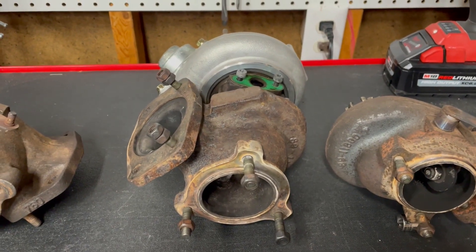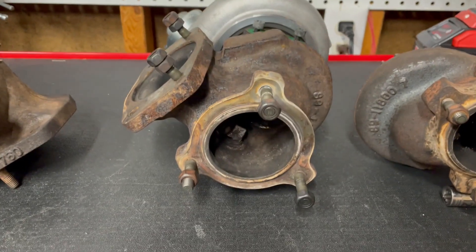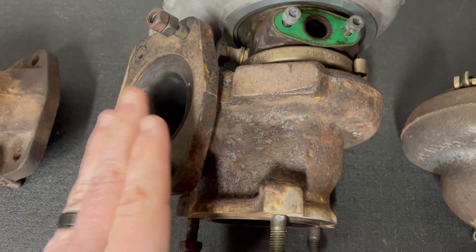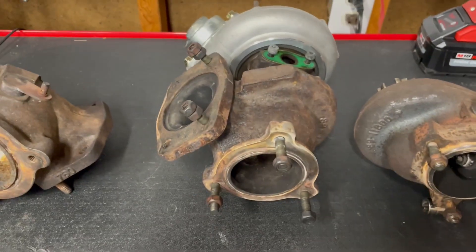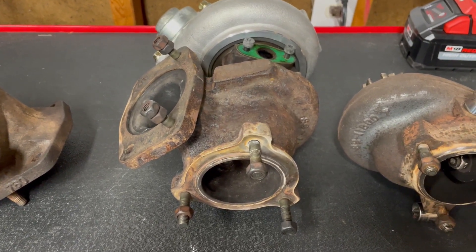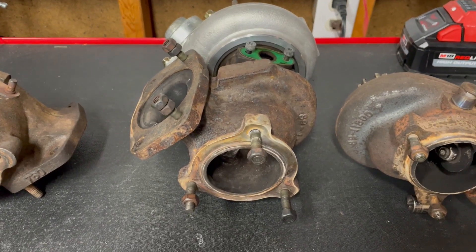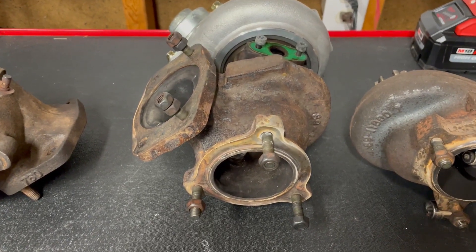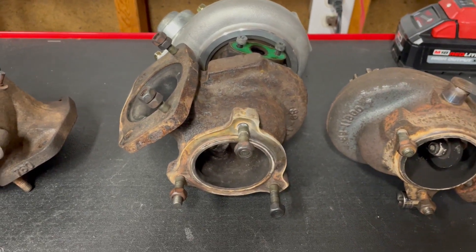Moving to the middle — this is a full turbocharger with the compressor and CHRA attached, but the only thing we're really talking about is the turbine itself. This is the straight flange. As its name suggests, it comes straight out from the body of the turbine, so it's perpendicular to the flange that mounts to the exhaust manifold. That makes it easier in terms of fabricating a downpipe. If you're able to get one from a junkyard, you'd want to take the downpipe as well, because you can cut off that downpipe — which matches perfectly — and have custom exhaust work done to mate it up to your OEM downpipe, or just have a full custom downpipe made. Having an exhaust shop make a downpipe with a flange that mates up to this isn't going to be as easy if you're not providing the actual downpipe itself.